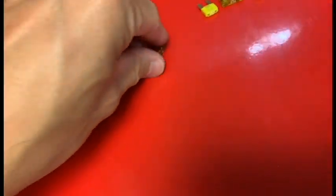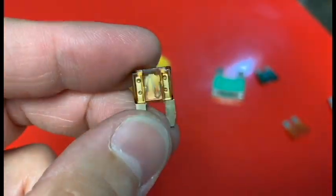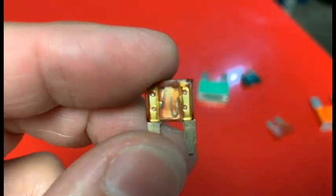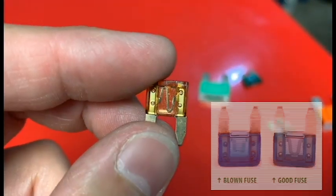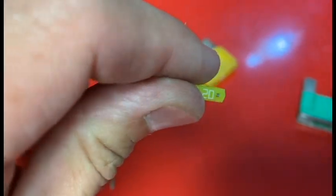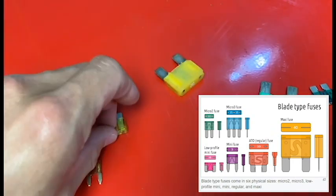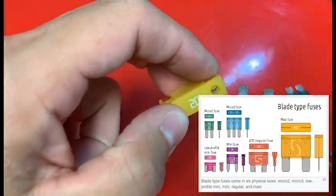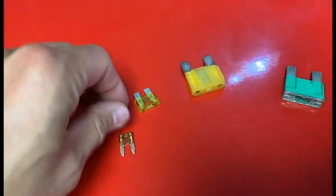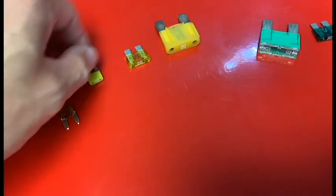When you're dealing with fuses, they come in all kinds of different amperages and sizes. There's a 5 amp — the number on the top is the amperage, it's how much current the fuse can hold. When the fuse goes bad, that strap in the middle will blow and it'll leave a black mark. Here's a 20 amp mini, a 20 amp normal one which they actually call mini, which is weird. And then this one they call a maxi. So there's three different sizes of 20 amps. You've got to see what you have before you can go to a parts store and get the one you need.